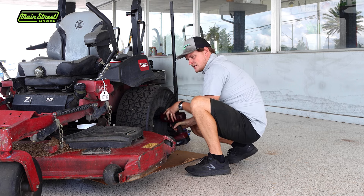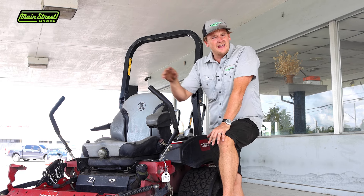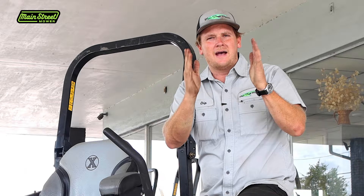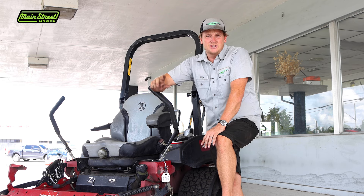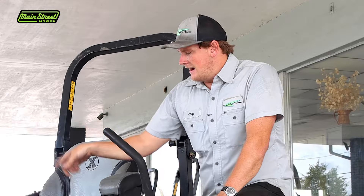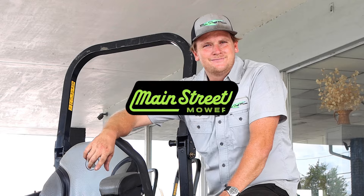Well, I hope that was helpful. That's a quick way to adjust your parking brakes. If you try to adjust them and notice you're still not getting any bite, your pads can be bad - they're just brake pads, you can order them at your local mower shop. It's not a big deal. Those are pretty easy to change too, but really start with adjusting - you'll be shocked how much life you have in those pads. Everybody, adjust your brakes. It'll save your mower and save you a lot of money. I appreciate you watching. Stay tuned for more helpful tips. See you later.